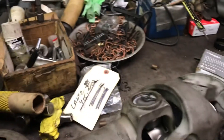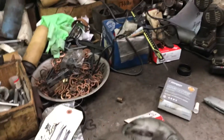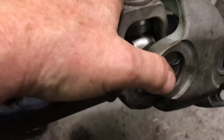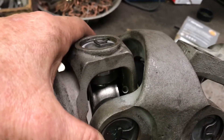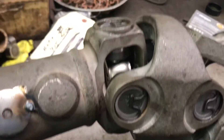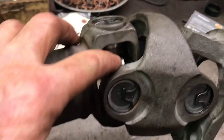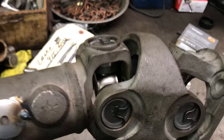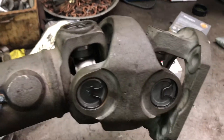They do it on the Dodges and you can access it with a needle grease gun. This is all new — new ball kit, new everything inside — so it's got plenty of grease in it now. It's a little unclear whether you can actually get to it with a skid plate on; on the older trucks there was no way, but on some of the newer trucks maybe you can. Put a little grease in it once in a while if you have the opportunity.